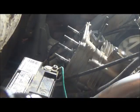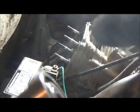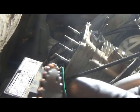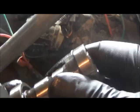Just like the valve rockers cover, you want to do the same thorough inspection. Make sure your bearing is still good. There's no grinding sound, no feeling of any sand, which would tell you that you got dirt in it, or had dirt in it before. Either way, it's got dirt in it, but this one doesn't. You want to look at your outside of your bearings. See if they have any grinding, rubbing spots. And look at your lobes.